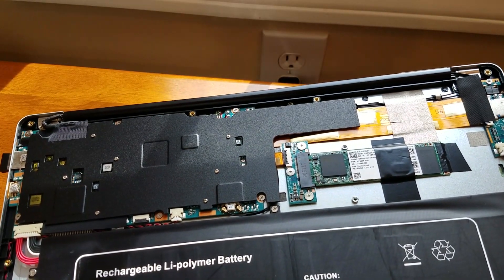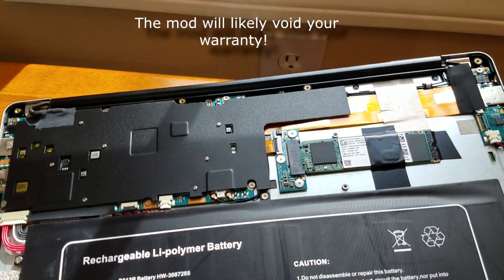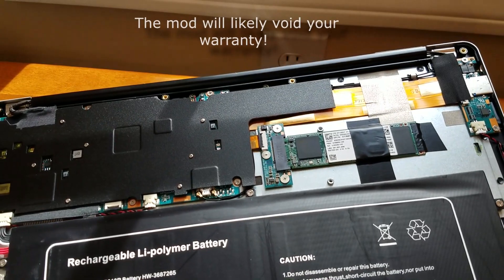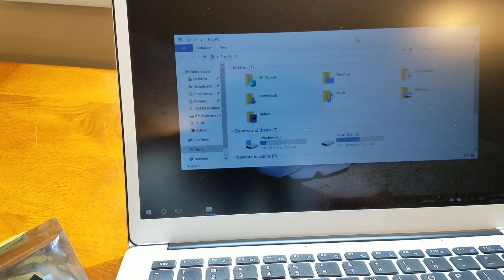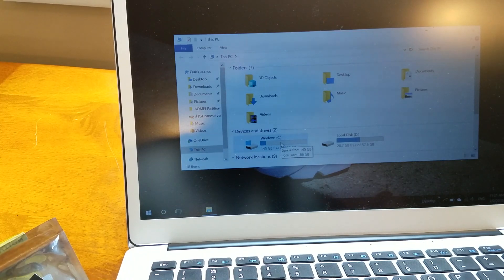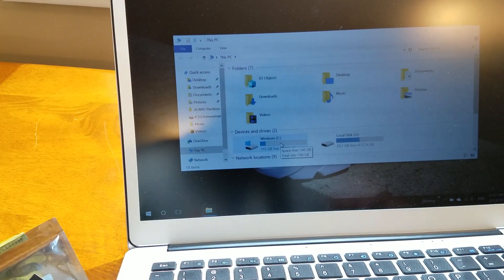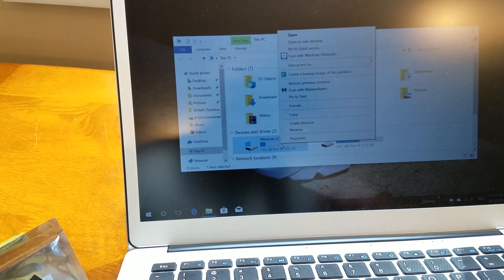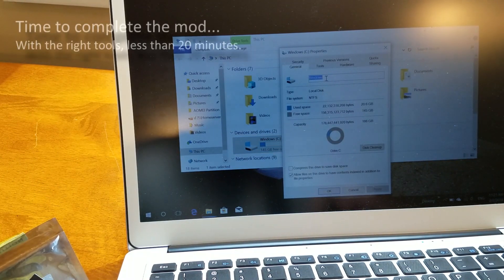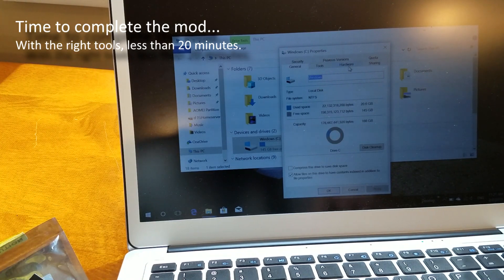Another warning: if you're relying on using the warranty on this, please don't do this modification. Me being located in the States with this coming from China, I'm not relying on any warranty claims, so I can do it on my own risk. After you install it, remember first to go to your BIOS and change the boot device to the new drive, because for some reason it defaults to something else — EFI or something. You've got to change it to the new drive. As you can see, we have the Intel SSD right here and Windows is running on it, no problem whatsoever.